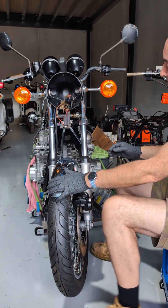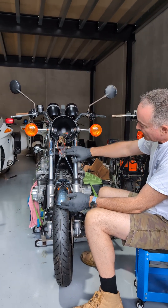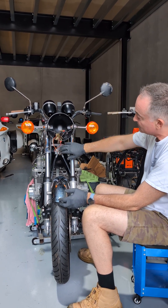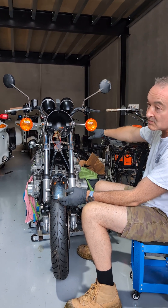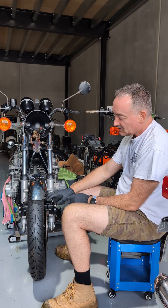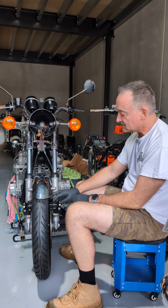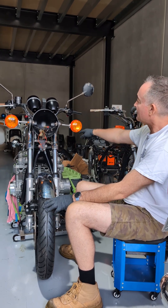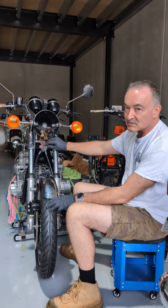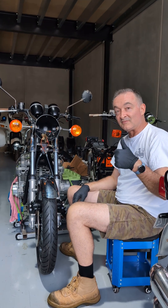So there you go — that's a quick install of the front end of our braking system. Worth noting these are completely independent systems — this front brake system has nothing to do with the rear brakes. This system is dual disc, single pad on each side, so four pads and two discs up front, with a single disc in the back as well. Not a bad system for a bike built in 1977 — well done Kawasaki. I'll catch you in the next video, cheers everybody.